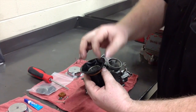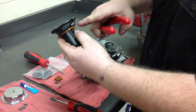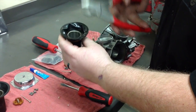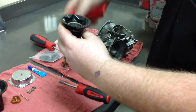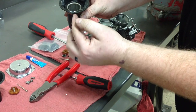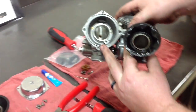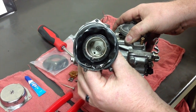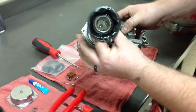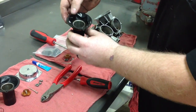When you're prying on this and trying to get the diaphragm off, on this one there's a top ring and a bottom ring. For ease of removal, take the top one off first and then remove the bottom one. Also, this flat surface goes right in front of your butterfly and lines up with the little ear on your diaphragm. There is a specific place where that goes, so mark it before you take the slide out — mark on the inside where the metal is, because that metal stays. That lets you know where your diaphragm is going to be installed so you can line the ear back up again and it drops back down into the slide where it belongs.